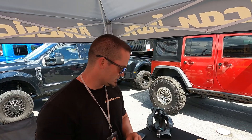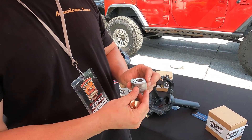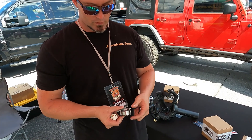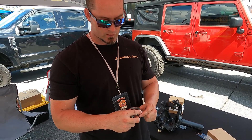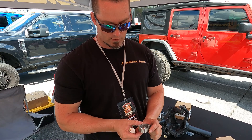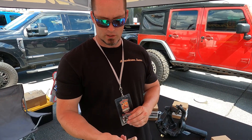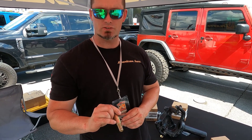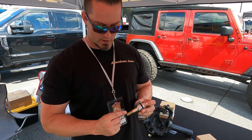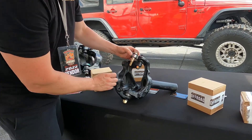First thing I want you to look at — I've got a cutaway model here. So literally we have a cutaway model with the cup, spherical, and you can see the seal and the shim. When you have this set up in the knuckle, this gets pressed into the hole with the spherical inside the cup. There's a C clip there — couldn't get it in with the cutaway. Your Viton seal with your shim, and then your zinc coated hardware actually has a taper that matches that C. After it's inserted, the C comes up and pulls it down when you tighten.